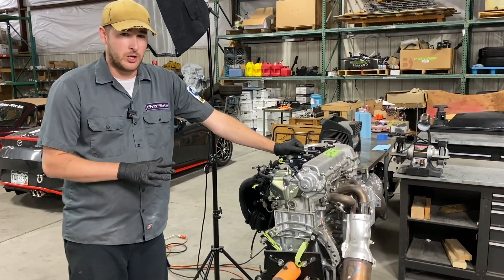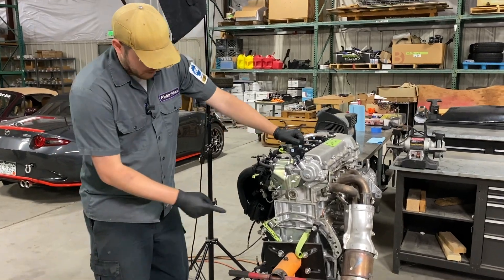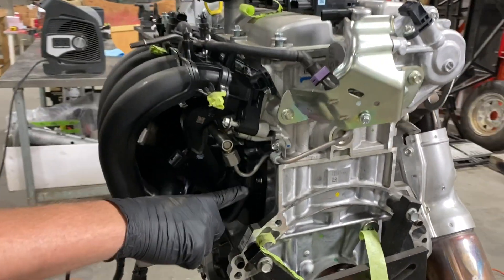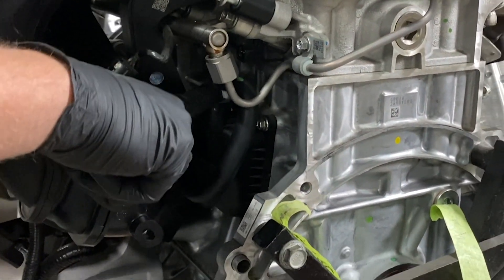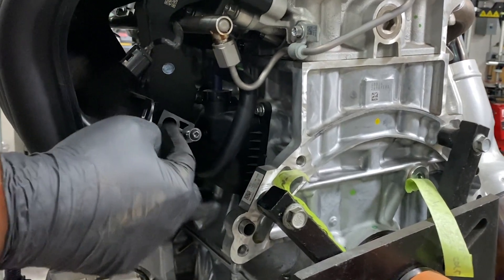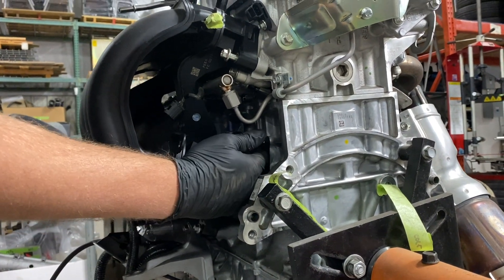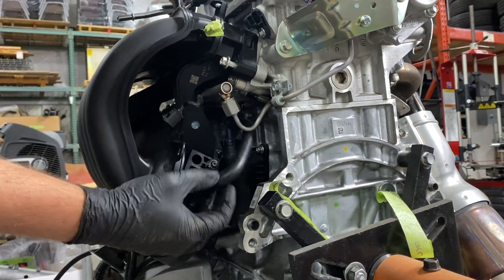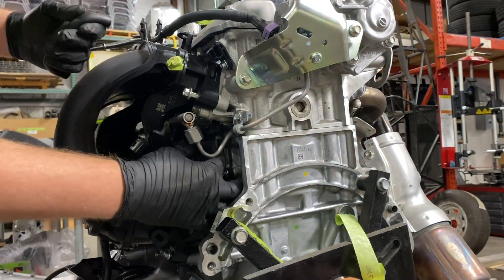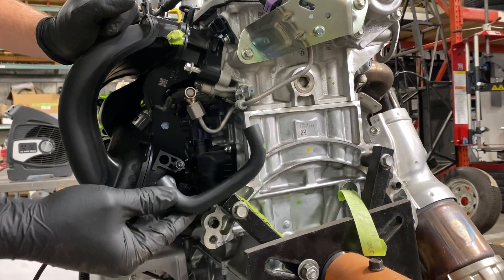Now comes the next step and I'm going to show it to you on a standalone engine since you're not going to be able to see it while I'm doing it on the car. We need to remove the existing PCV hose — it's this little circular hose here. It goes from this purple-colored PCV valve down to the bottom of the intake. Normally there would be a sensor here; it's not here on this car. So it just pops off of each end. You do want to be careful with the PCV valve — it's plastic, you don't want to break it. So you're going to fully remove this hose.